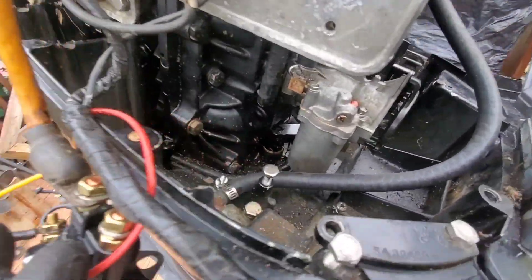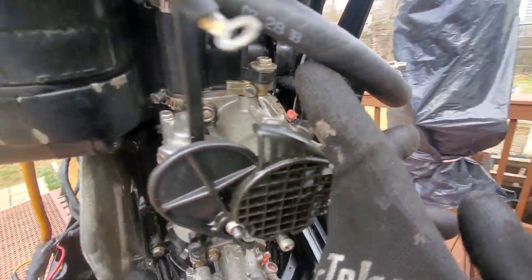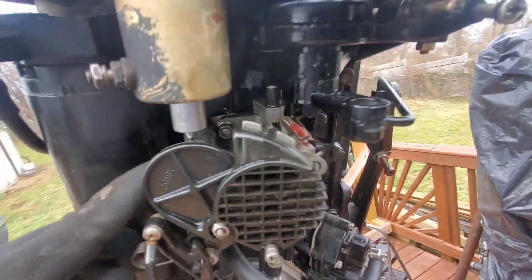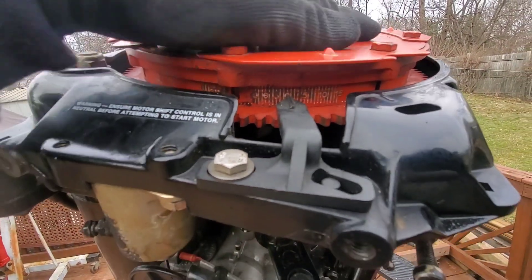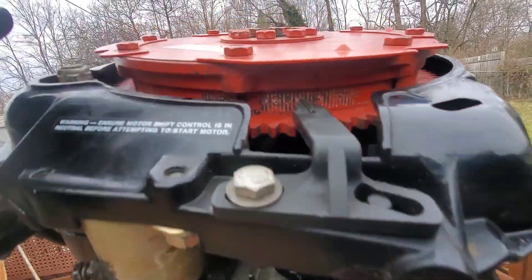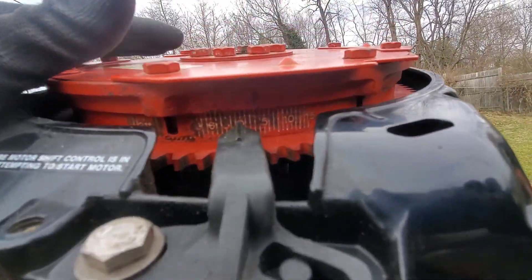Quick look over here — I've got the fuel line brand new, installed with stainless steel clips running all the way into a brass tee fitting. Everything has been retrofitted, non-zip-tie. The previous owner did have it set at TDC, so after I did my piston stop method I just put the cowling back on and didn't even have to move the pointer. It's always good to double-check — never assume the previous owner had it right.